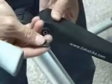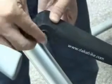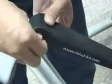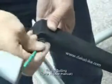The hexagonal head nuts are inserted from the inside of the seat stay and rear pivot. They must be arranged on the inside until they sit within a recess. Then the steel washer and fastener, again with an anti-vibration thread lock adhesive or compound added, can be inserted.